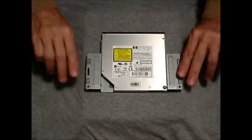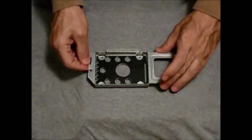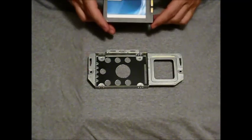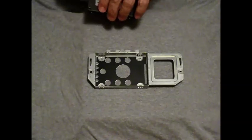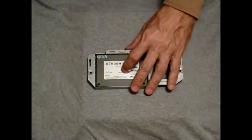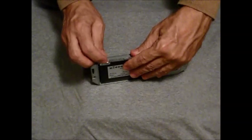The completed installation in the tray of the Blu-ray drive. Install the hard drive in the hard drive tray — in this case a Crucial M4 64GB SSD. The drive is held in place with four of the provided screws.